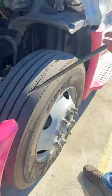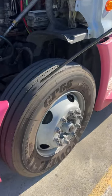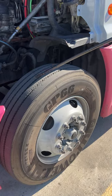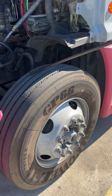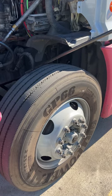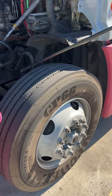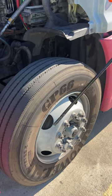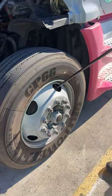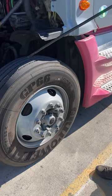And we make our way out to the tire. Our tire is properly inflated to 100 psi or manufacturer specification. I will check the tire pressure with the tire gauge. There are no abrasion bubbles or cuts, no rips or tears, no nails or screws. The tire depth is evenly worn — the minimum tire depth is 4/32nds. My valve stem is present, has not been broken or cracked, and is not leaking. These tires cannot be recapped.